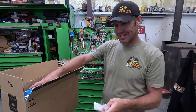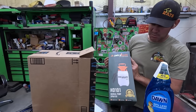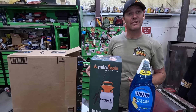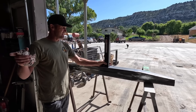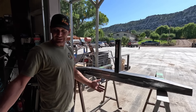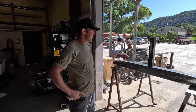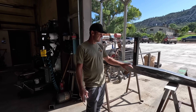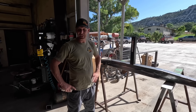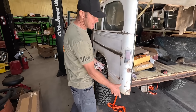We've got one last package. Jason says this is the best wasp killer there is. We are back on the Pack Rat. We are going to go ahead and get the rear bumper built and welded onto this rig today so that we can put a fuel tank in it. This will be the rear cross member - we have to cut one out of the frame, we need this to hold it together. John's going to get it all marked up, put the receiver hitch in, get it all built and welded to the frame.